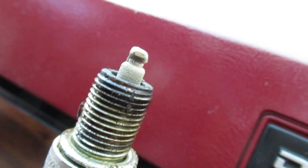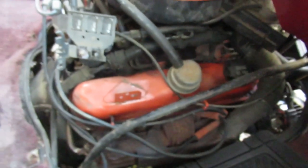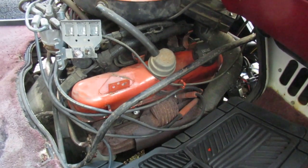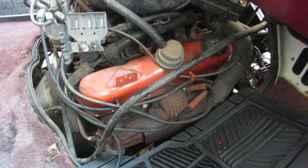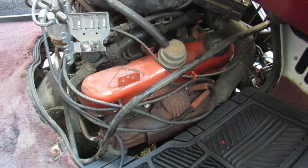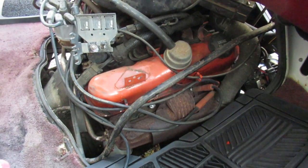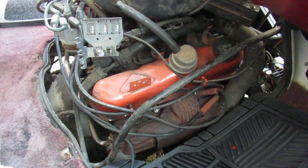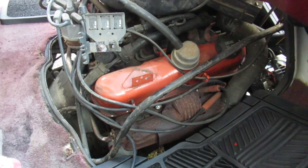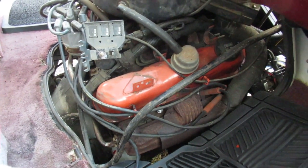Once a year I've got to change the spark plug because it bridges over — you can see it's doing it now. I think I know that's the cylinder that's burning oil in this vehicle, because it does burn some. I'm going to give it one more shot here to cure this. It's not a problem with the engine — it's been burning oil for years, it's not getting worse, and it's not affecting performance other than that one spark plug. If you end up buying the van, don't worry about it. Hopefully I fixed it by doing this video, and if not, at least I tried.